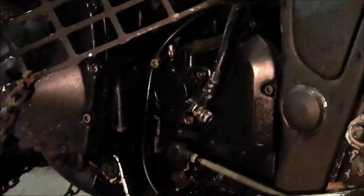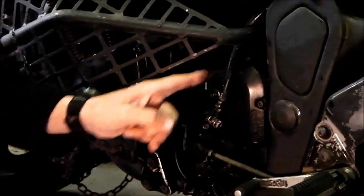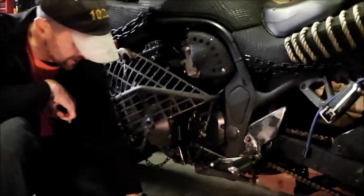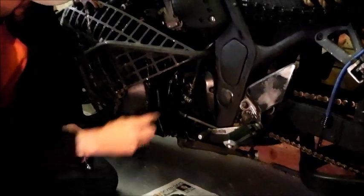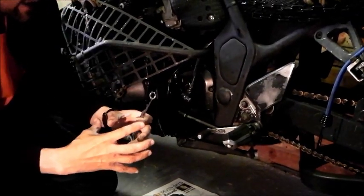This is the slave cylinder - slave because it does what it's told by the master cylinder. Master cylinder at the top: when you pump the master cylinder it pushes down and the slave cylinder does what it's told. So the slave cylinder in any situation is the second cylinder in the chain. Now that casing - the cylinder itself only comes off inwards. You can't pull it out even though there are bolts showing. You have to take the casing off, then take it off the inside.